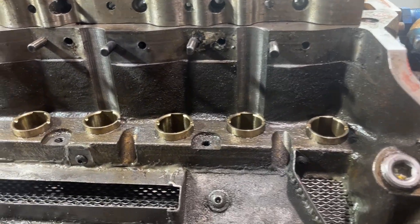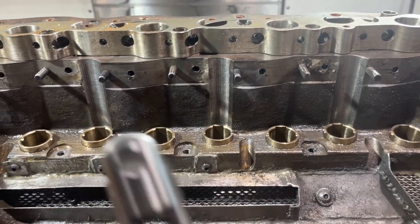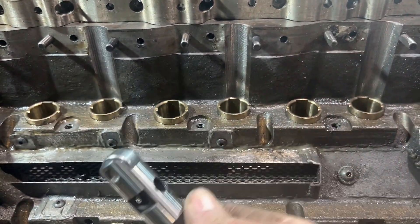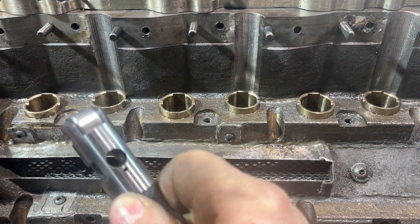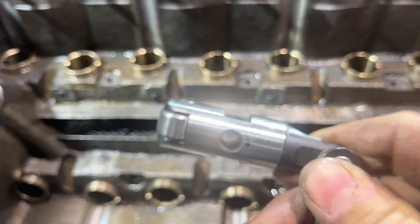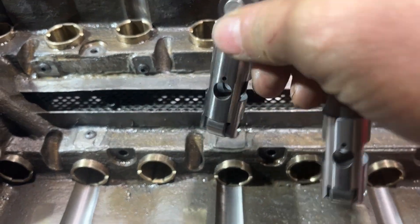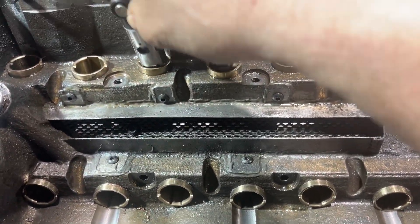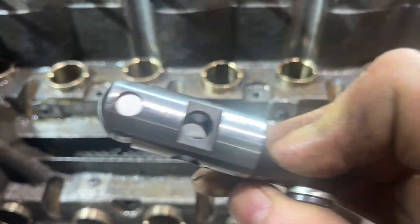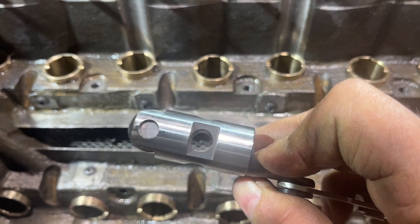What a wheel-guided lifter is, if you've never seen one — this is a standard 875 BAM lifter that we use quite a few of. This has a 750 diameter wheel. As you can see, this 875 lifter is pretty small for that hole, and the wheel stays inside of the body of the lifter.